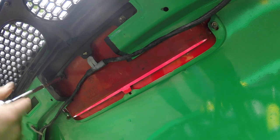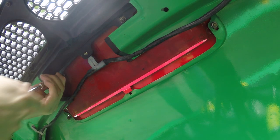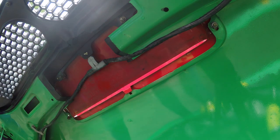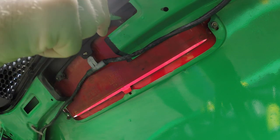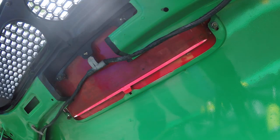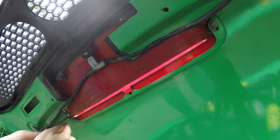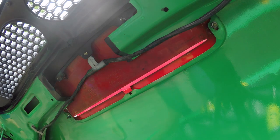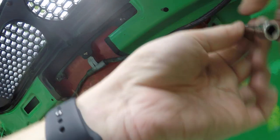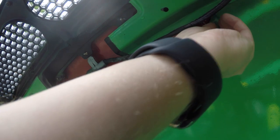So we've got our 8mm socket — I've already loosened these off. Make sure you don't drop these under the bonnet into the engine bay. Literally eight mil bolts — put them somewhere safe because you may need them to reattach your new scoop. That's two... third one all the way over here at the back... three... and we've got one just up here... four.